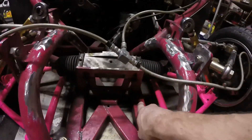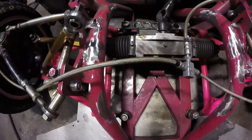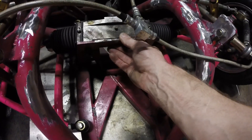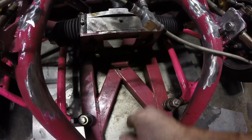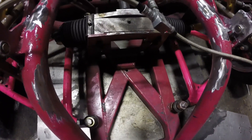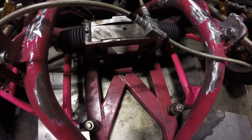Another change I need to make to the car is to move my steering rack forward. Currently my steering rack mount is welded down there, and obviously I can't just move that forward. So I'm going to cut off this mount here, get it recreated out of aluminum instead of steel, and make it as a whole piece that can slide forward and back so I can change the rack very easily — instead of the current way where I need to cut and re-weld stuff.